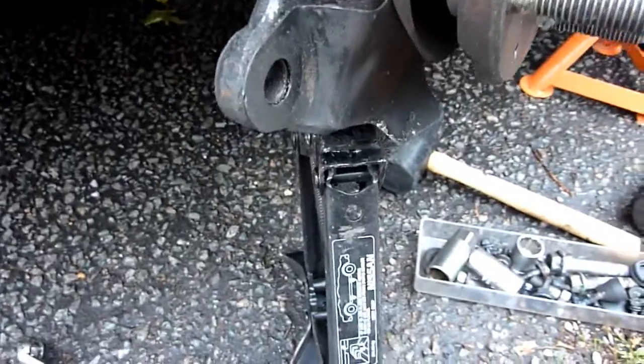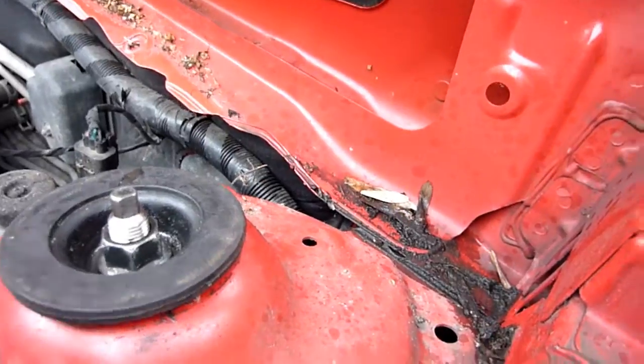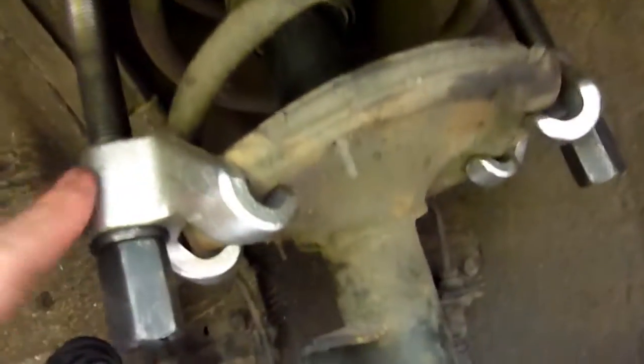I had to check the bottom knuckle - it was at an angle. The correct order: take the little stabilizer thing out first because it's under a lot of stress, then it goes in that hole. Take the little sensor out and the little pipe out. Keep this in and don't take this off first - I had to put it back and it came crashing down. Break the bolts first, then proceed with the top because it came crashing down - luckily the bar caught the driveshaft.